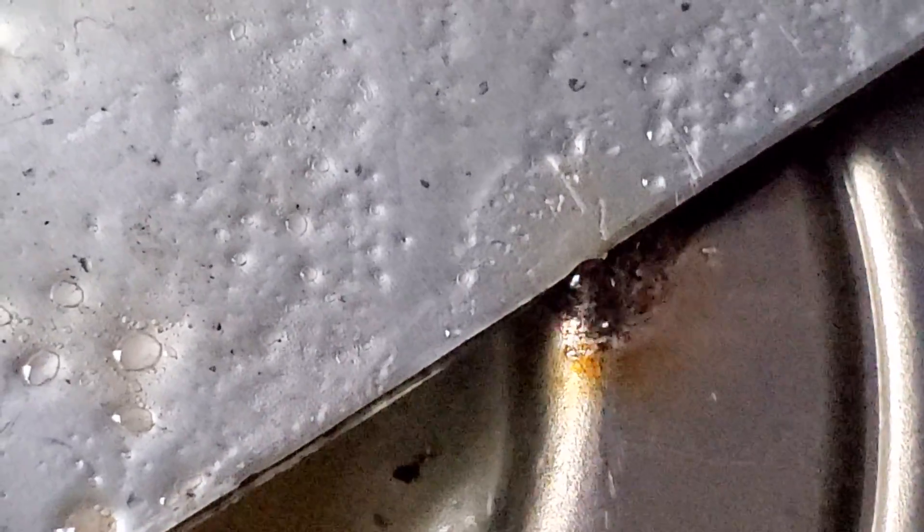That little rust hole actually caused the gas to leak — you could drive down the road, look behind the car, and see a wet trail. I've already pulled off the gas cap so it's no longer pressurized. That's just leaking out the fuel pressure regulator. So if you have a hard start and you've got your access panel, you know where to look for it.